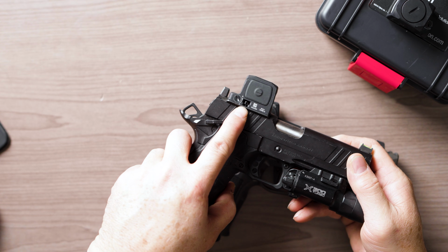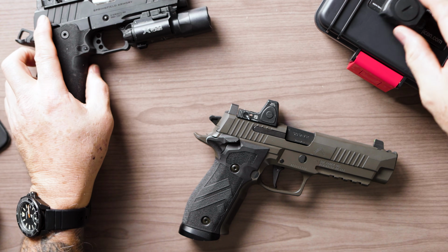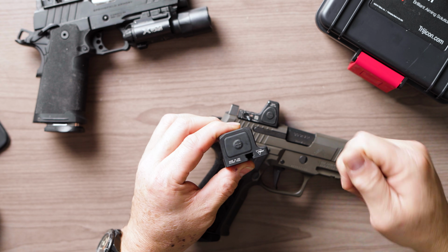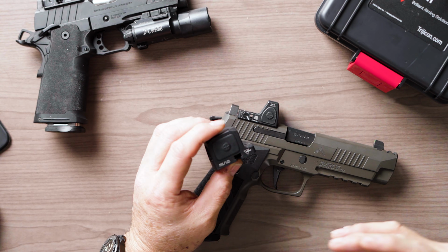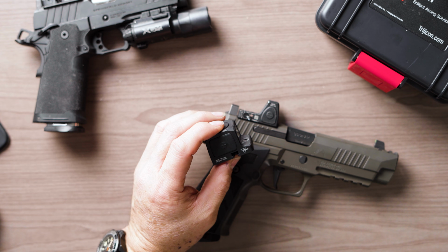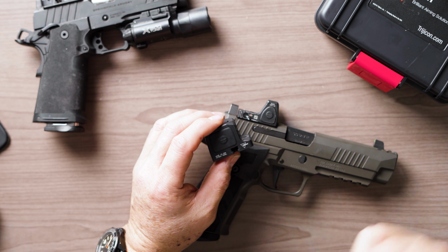If I slander that, you guys, I apologize, but the proprietary screws that mount the RCR, you guys will see them here in the Prodigy. If you look in here, you'll see the screw head's got a little pass-through hole. And how that works is the screw goes into the slot here, and you use the Allen key to rotate it down. That screw style comes from the marine industry on boats for anchors, so you can wrench that to bring that up and let it down.